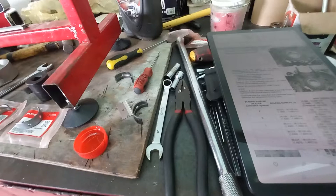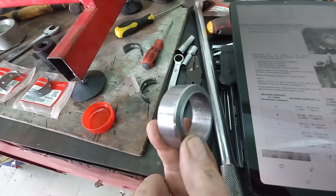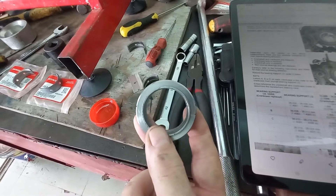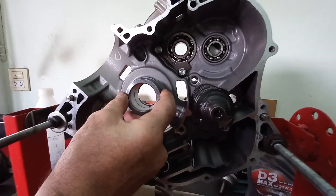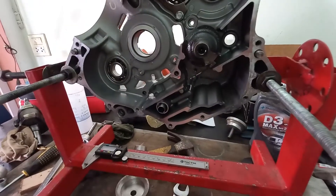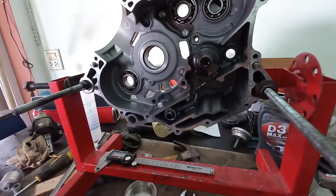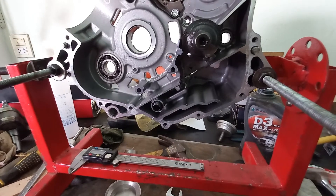I've made a tool that the bearing sits in. It's supposed to be in two parts but my engineer made me one in one bit, and it sits up here with a tiny little recess so it just sits in the mouth of the crank. I put a couple of slots on it to line it up with the little arrows here. The reason you've got to line the bearing up with the arrows is because your main oil feed hole has to line up with the hole in the crankcase. So we're just going to fit these bearings up in this tool and then have a go wanging them in.